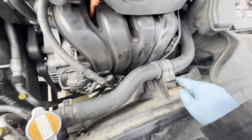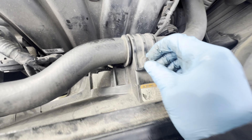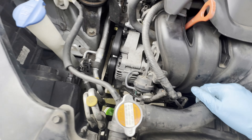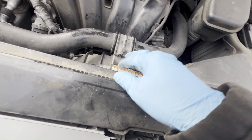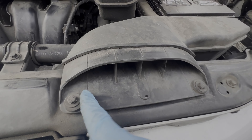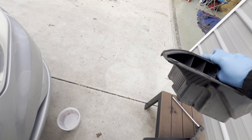From the top, looks like we're gonna be removing the fan. This hose has a 10 millimeter here — you can disconnect this now, then remove this part too, the intake, and the fan. This one has two 10 millimeter bolts here. Once you've got those two out, this just comes out pretty easy. Put it to the side.